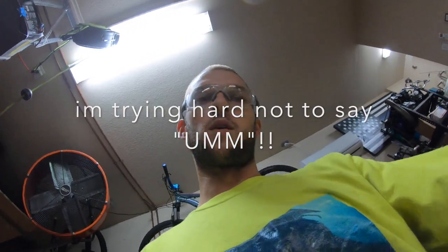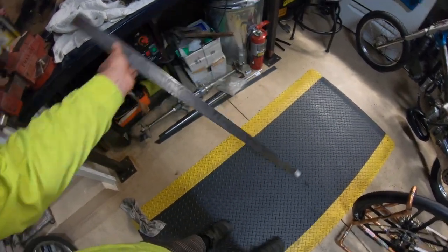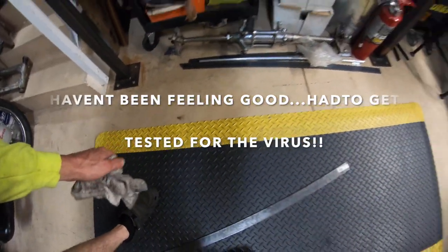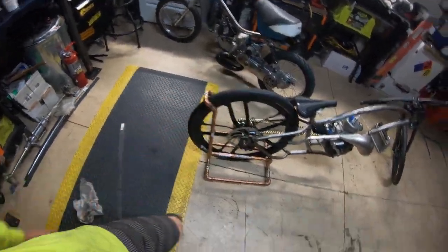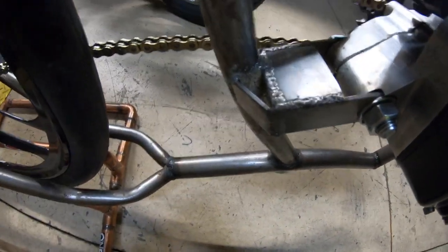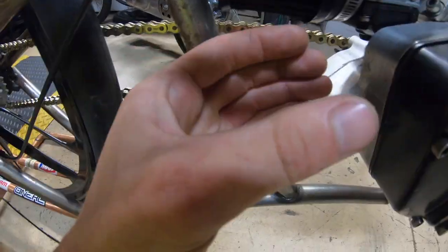I made a radiator mount to mount the radiator up so I can take it off my workbench. I added a gusset for the motor mount on the rear side — I only welded the top bit, I still need to weld underneath. I'm using about inch-and-a-half, I think eighth-inch thick steel, nothing crazy. It's pretty flimsy but I didn't want to go three-sixteenths since it's only a support so the pieces can't flex in and out. That little plate helps keep the motor mount straight.